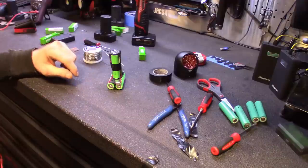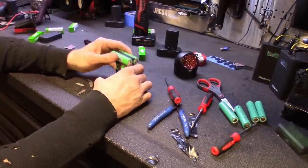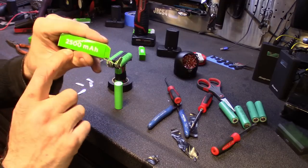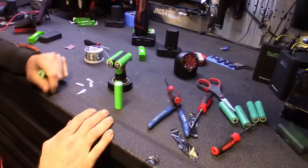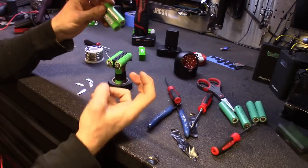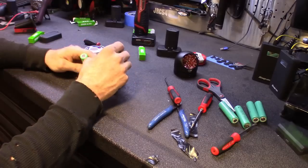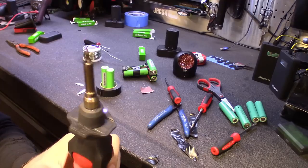We've upgraded the batteries from 2.0 to 2.5 amp hour with better Samsung cells. Now the upgrade from the upgrade is to add two more batteries in parallel. We're going to hook up positive-to-positive and negative-to-negative on the lower row batteries, which gives us more milliamp hours without changing the voltage. The batteries will still sit at 7.4 volts — 3.7 plus 3.7 — which Snap-on calls 7.2. First, let's get these new cells sanded and tinned.